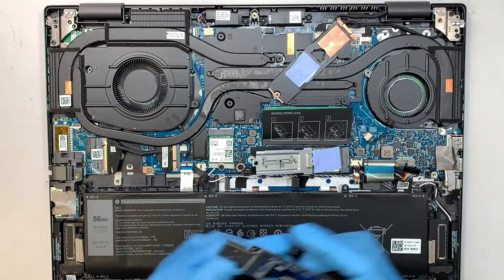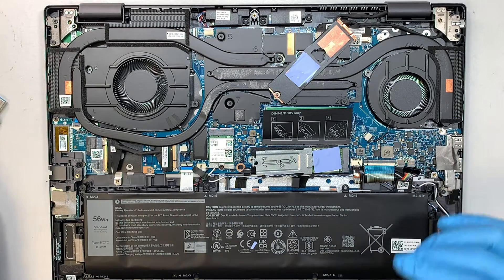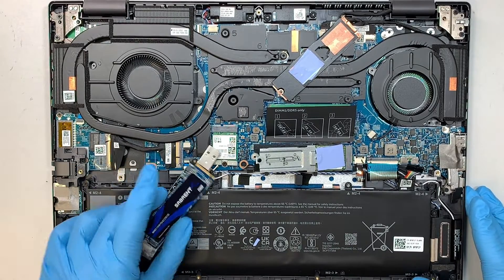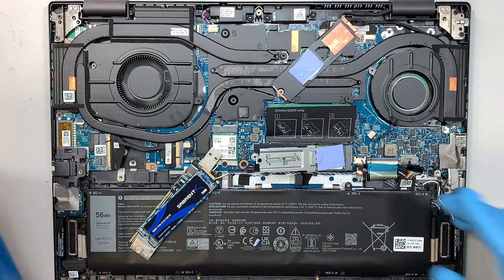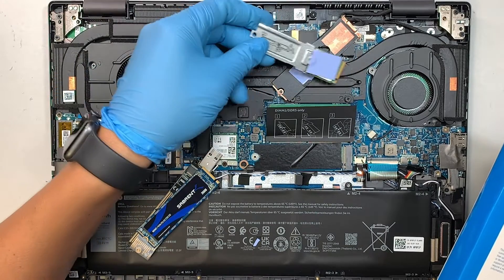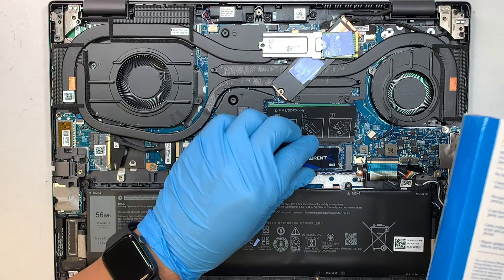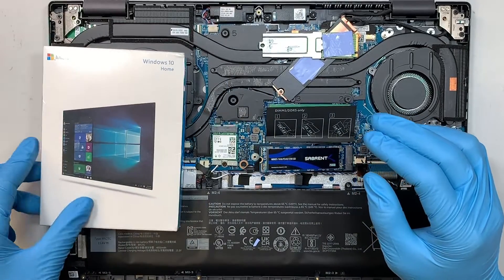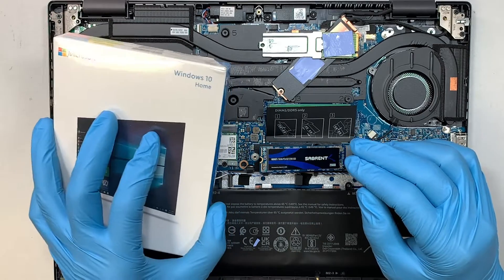That's one way to do it. In this video I'm not covering the cloning process since it's long — I've made a separate video for that, linked in the description below. The second option: if you decide not to clone, or your old drive is broken and can't be saved, buy a new M.2 drive and get a Windows USB installer. Install a fresh copy of Windows onto the new drive and you'll pretty much have a brand new computer.